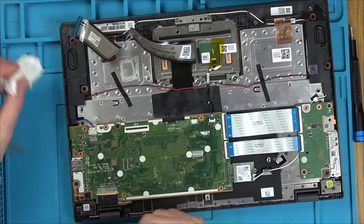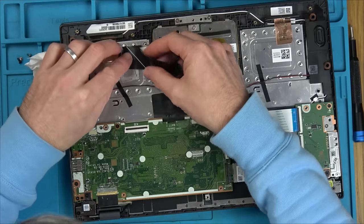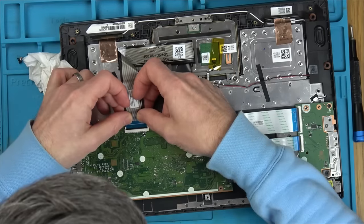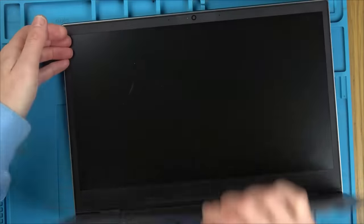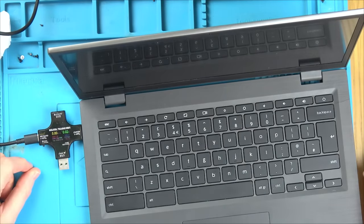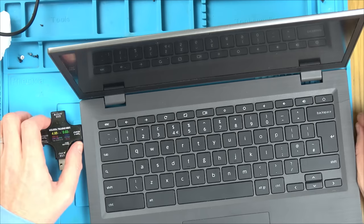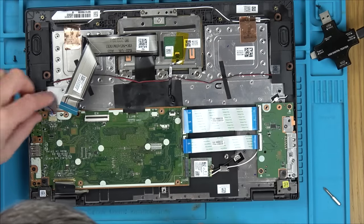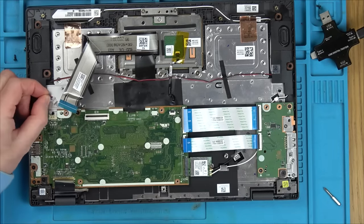It doesn't smell foul. It looks like it hasn't been bent in the proper places. Right, that's seated nicely now. Let's try plugging it in without the battery and see what it does. Still the same — won't turn on. That connector must be for the touchpad, this one's for a speaker. Both speakers are linked — this speaker links to the other one which comes up here — four wires total.